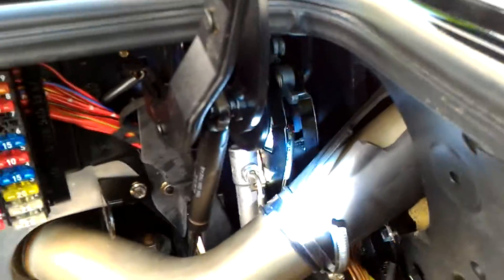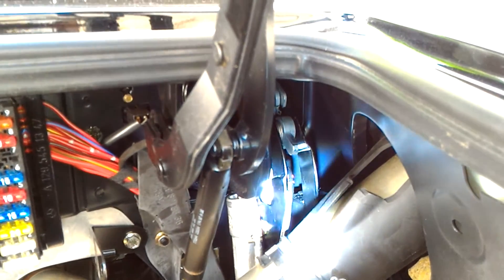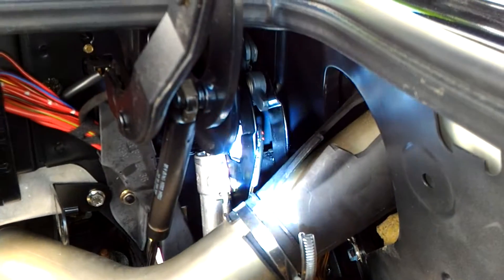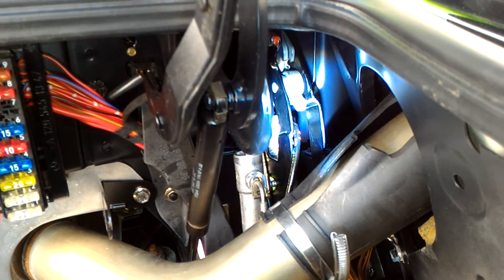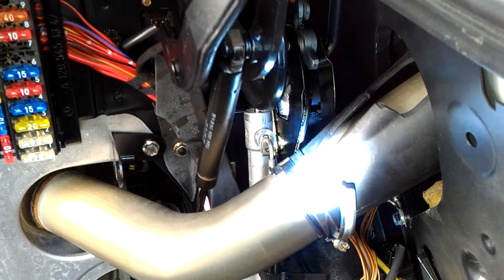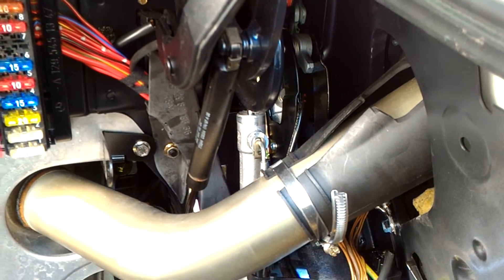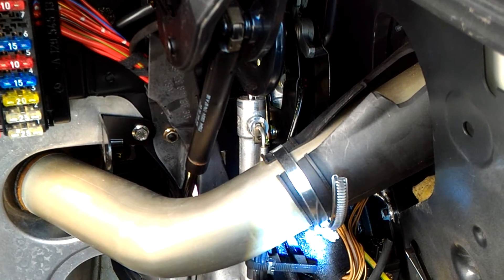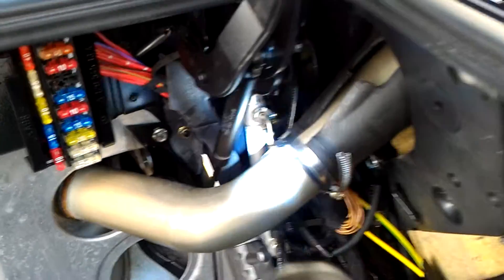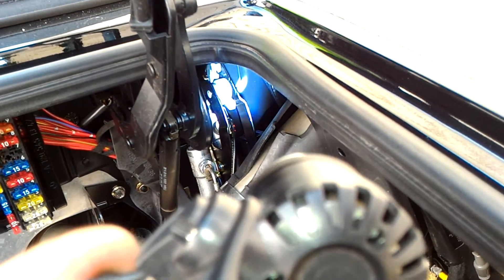That's not even from cycling the roof — when pressure built up, I actually only activated the roll bar, which usually never leaks. But these roll bar cylinders, they usually never leak, and this one is clearly leaking badly — actually really bad — because the system pressurizes when you cycle the roof. Obviously if we have pressure in the cylinders, it's going to start squirting out regardless. Solenoids activate the return lines and then we have activation of individual cylinders, so we have pressure coming through all of them. And so far, this is the worst one — it's squirting out badly.